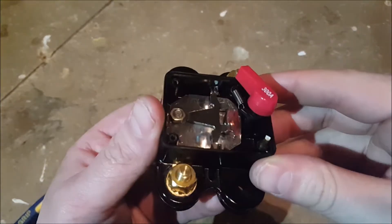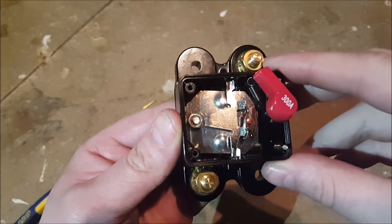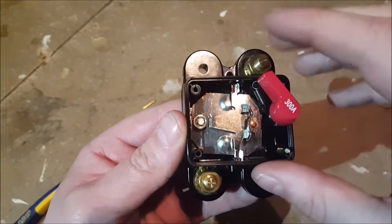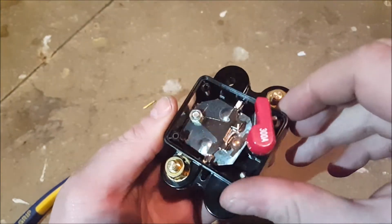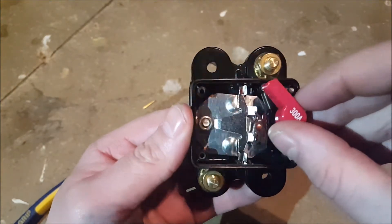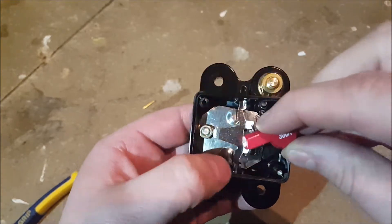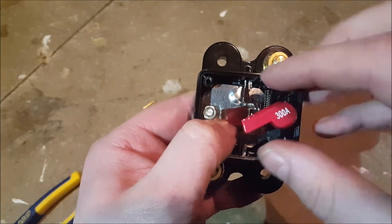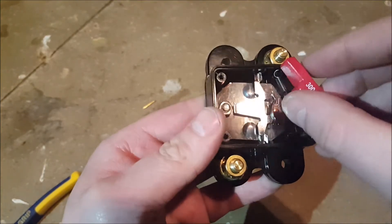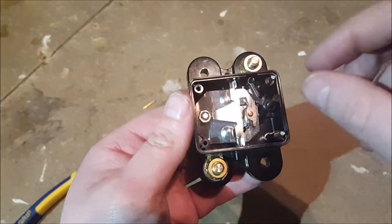Here's a lovely inside view. It's made up of a bimetallic strip — a square one so to speak. I've already had a look in here so I'm cheating a little bit, but I didn't want any unexpected surprises. The arm triggers down, the strip is pushed into the contact and then triggered up. What failed in this was the trigger here had become misaligned.